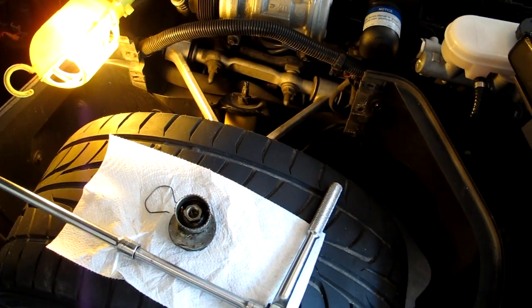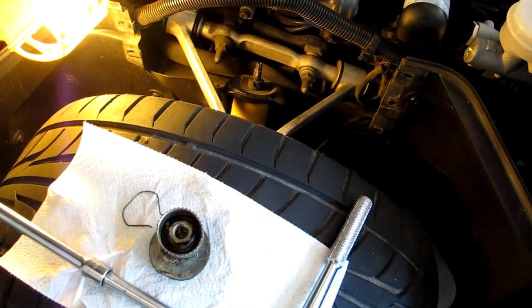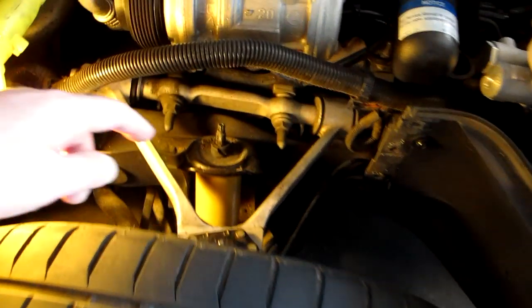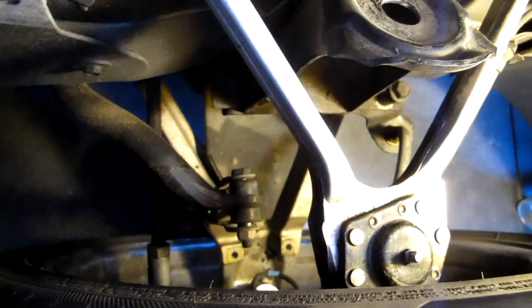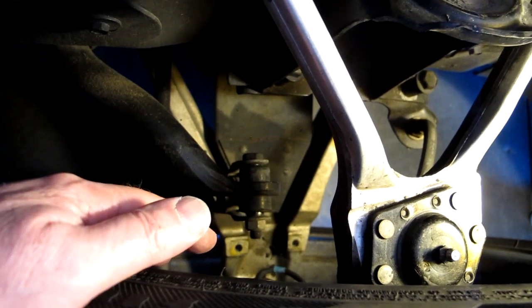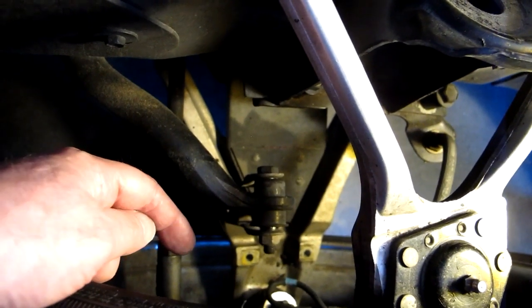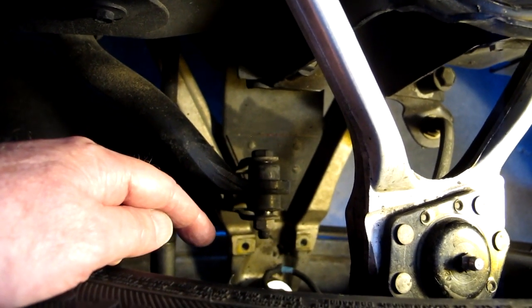What I've done after taking off the trim plate, this is on the driver's side now, taking the trim plate off there as well as on the passenger side, and I have removed the selective ride control mechanism from the top of the shock. It came off of here, and it is here. Was actually able to get the shock out without taking the wheel off. You can see the two holes for the bolts that were being a problem down there. They're 13mm, and I was able to get another socket wrench with 13mm on the bottom, and there was enough clearance between the wheel and the bottom of the arm there that I could grab hold of it and hold it and then turn the top one, or vice versa.